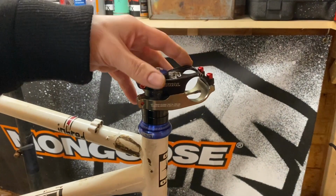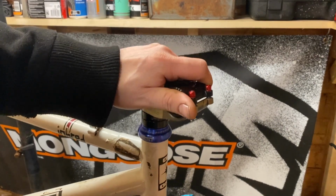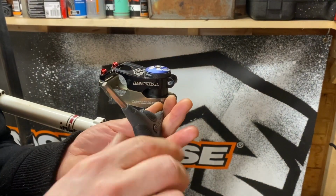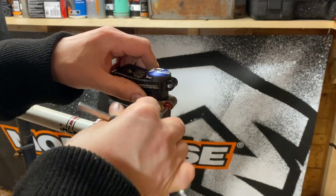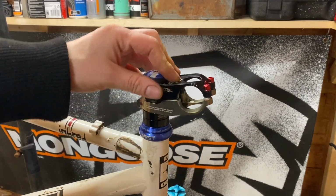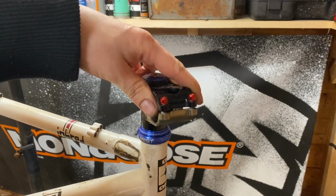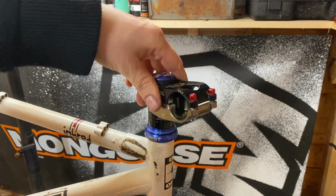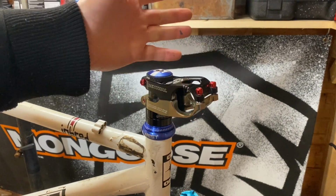You'll know if you've not got something right, because it won't be smooth like that. So there should be no play and it should be smooth. You know you've got everything in the right place. Some customers' bikes have come in the past with, you would not believe how they've arranged the headset, wondering why it's not turning smooth. Easily done, easily made. It's easy to get it wrong, that's what I'm trying to say.